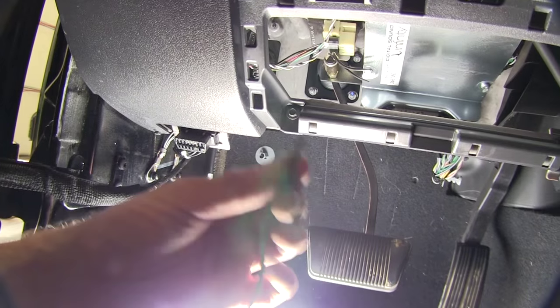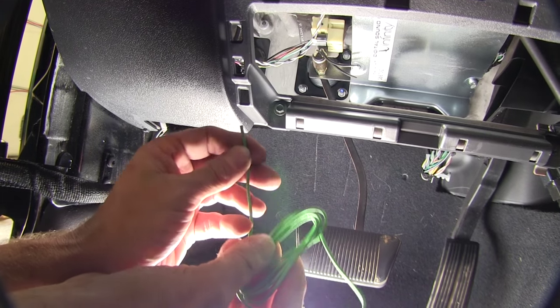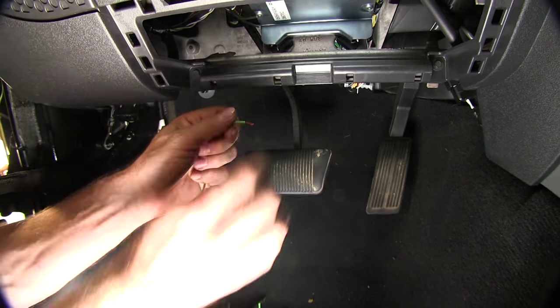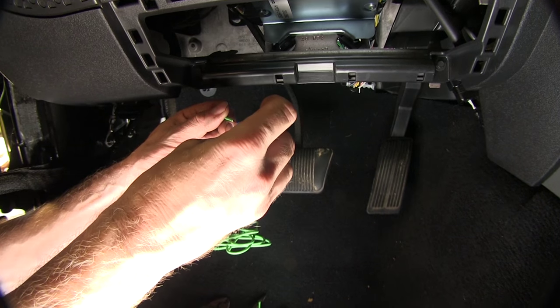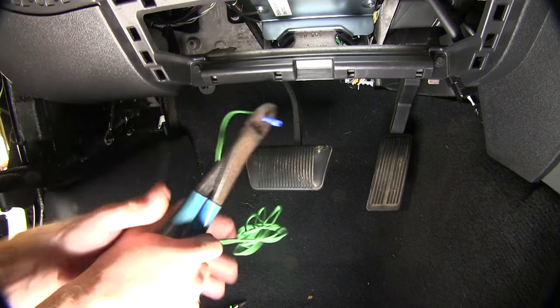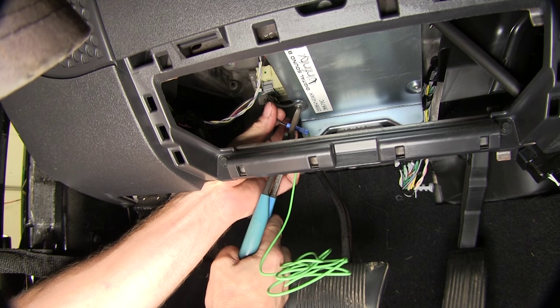Let's go ahead and hook up some wires. First we're going to work with the green wire. This will go out to our indicator light on your supplemental braking system. We'll strip the wire back and use the provided butt connector, connecting one end to one of the wires on the switch. The switch doesn't care which wire you use.